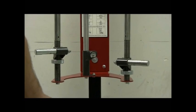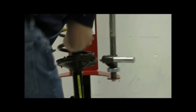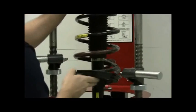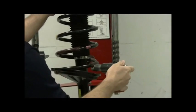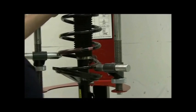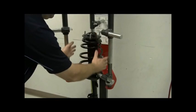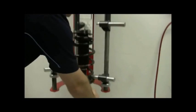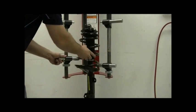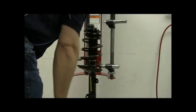To load the strut into the tool, pull the rear hook out, then place the strut in and engage the lowest coil on the spring. The spring goes up from right to left, so the right hook comes in here and the left hook there. Make sure all hooks are about equally spaced in. You want the coil to be parallel with the front and back posts, since the strut cartridge runs at an angle — always make the spring parallel with the posts.